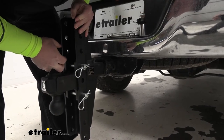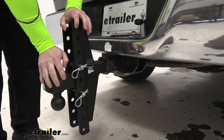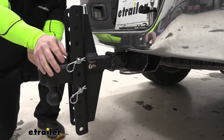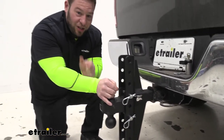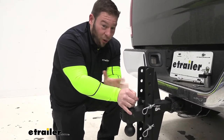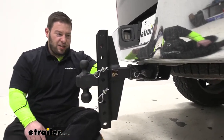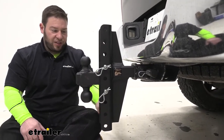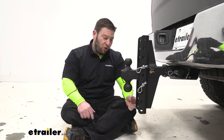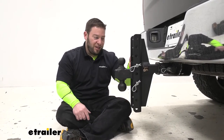Sliding it in and lining up that second hole — you can see how much more of it's in there, going pretty much to the back of the hitch, giving you just more strength for heavy duty towing. Now, just because you have this doesn't mean you can tow the maximum capacity, so make sure you check your hitch and see how much your vehicle can handle. With that solid steel shank, there are also gussets that add extra strength and support all the way up and down the ball mount.